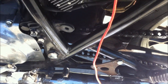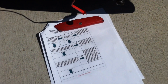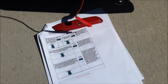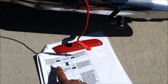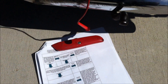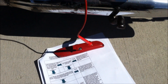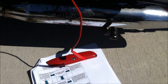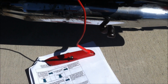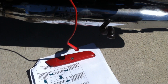I'm going to start doing the diagnosis sheet here for my stator. I printed this off of GS Resources. Since I already did my test with a good battery and I know that my voltage is lower than 13.5 volts when I'm revving the engine up, I have to move on to the next step, which is going to start diagnosing the rectifier and seeing if there's any issues with that.